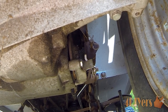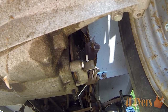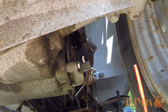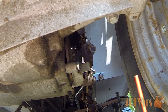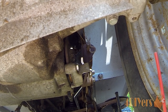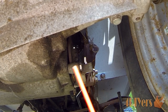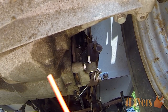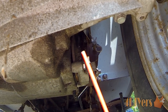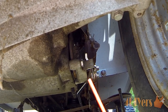With my orientation here, I'm at the rear of the tractor and I do have it up on ramps so it's easily accessible. You can go ahead and remove the right side tire, but at times the rim will be seized to the axle. If you get too forceful it can actually pull a shaft out of the transaxle and break the clip inside, meaning you'd have to pull the whole assembly apart. This is why I recommend just putting the rear up on ramps.